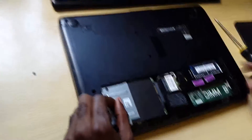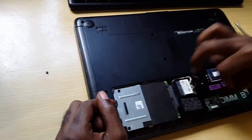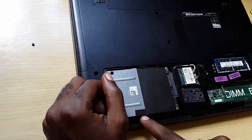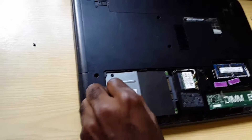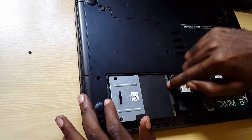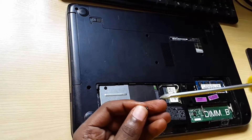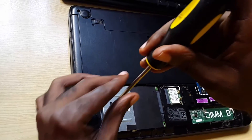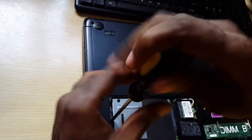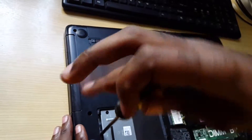Slides right in from this angle, then back. Use this tab and slide it all the way up. Sometimes you have to watch out for these tabs — they'll sit flush, but as long as they're not being obstructed, it should be fine. Apply pressure and it should slide all the way up. It should be snug and you should not be seeing any connectors. Get your screw — if you have a magnet, use it to hold the screw at the tip, then make sure it holds and begin screwing the hard drive back in.